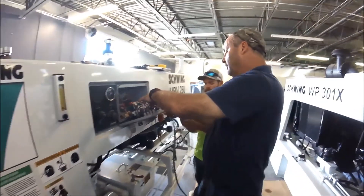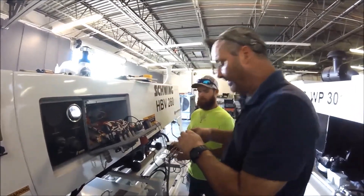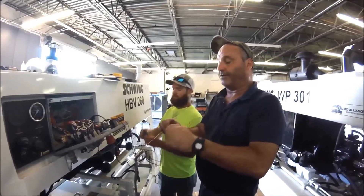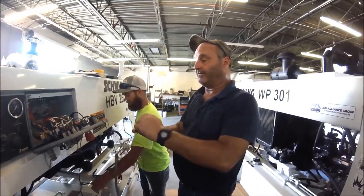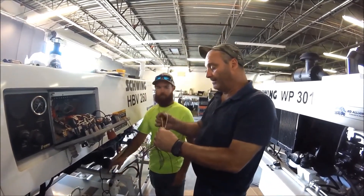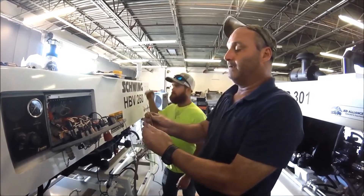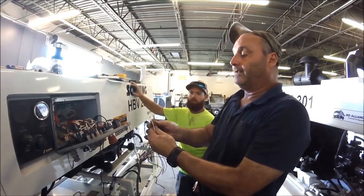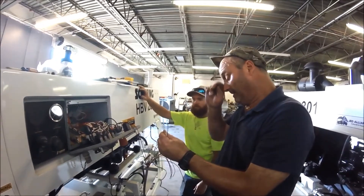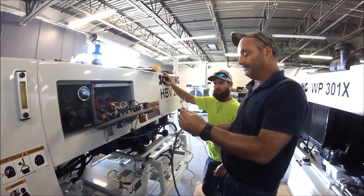So if you can think of this: you're going to be hooking your gray wire and your white wire together, and that's going to be for your power on your toggle switch. And then you're going to hit your yellow wire for reverse, and the green wire for forward. So those four wires you're going to use for forward and reverse. And then you've got your accessories if you have them.